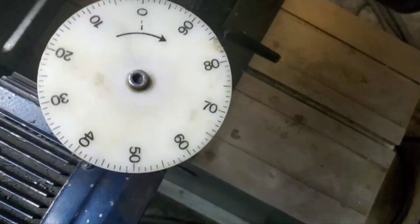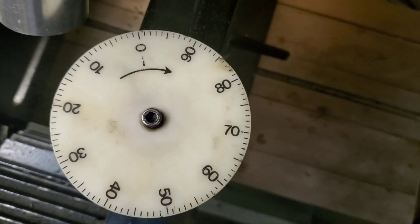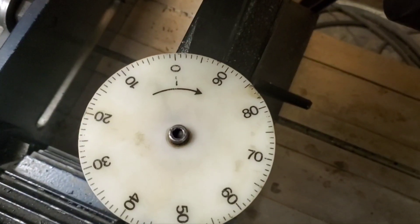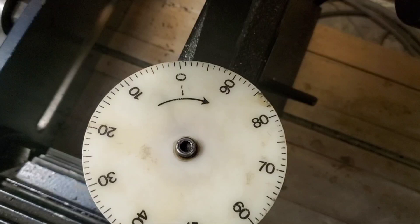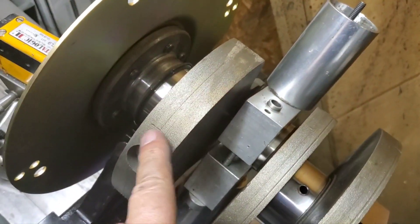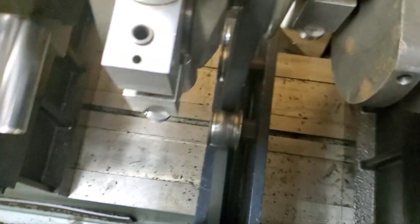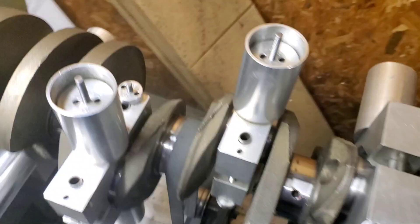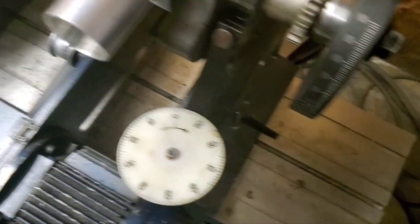Number one is, and some of you guys watch the channel on my wheel here. The back — I usually put the number one throw straight up, top dead center. The rear, I try to have between 90 and zero. That would be right over this area of the counterweight, right in this zone. There will be in the center where that hole is right there. So it's not too bad, it's a little bit off in the position, but we can fix that.